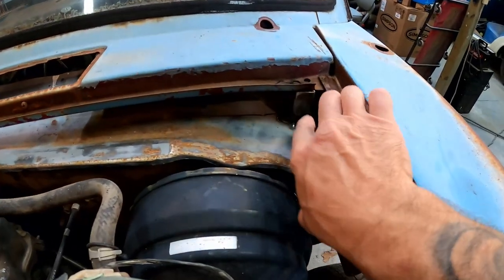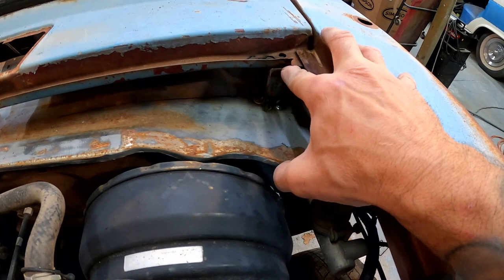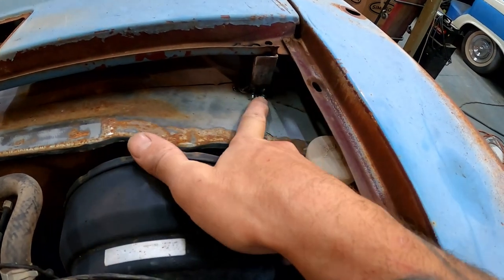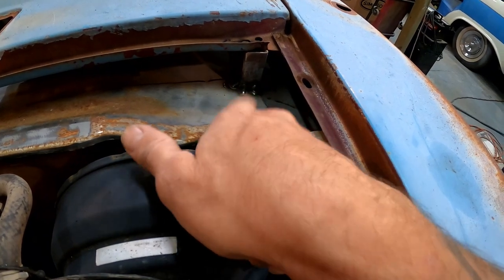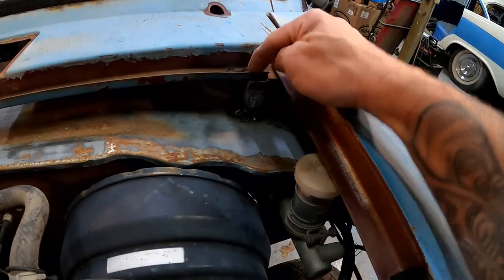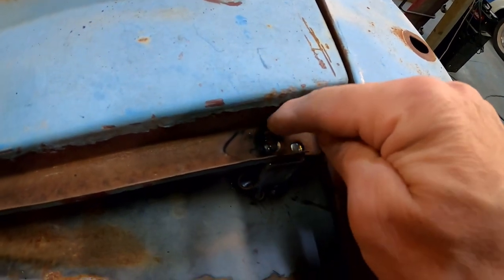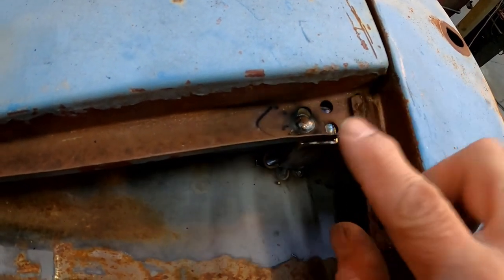Look, this is what I did — I made a little pedestal here on the side, just box square tubing, one-inch square tubing. It had a funky little shape down at the bottom so I had to contour the bottom of it to fit so that it would sit on here and still be straight up and down. And then look — our factory spot welds from the old Datsun cab are perfect to come back in and plug weld. Now we are fastened in.